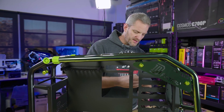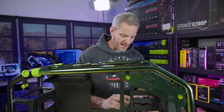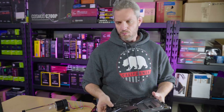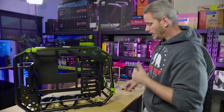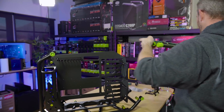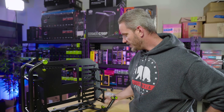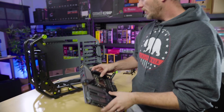When I'm preparing for my loop, it's important to make sure I have the main components in there so I know where things are going to line up, because you can't just eyeball it. At the very least we have to get GPUs and motherboards in there. For this build I'm going to be using my X299 Rampage 6 Extreme — extremely overkill, honestly. I made the decision to go with X299 instead of Z370 because I'm probably going to have two NVMe SSDs, and with two graphics cards wanting 16X in both for Gen 3 PCIe, I don't want to go through PCH. I want everything communicating directly with the CPU. The difference is probably negligible, but why not.